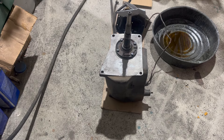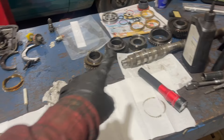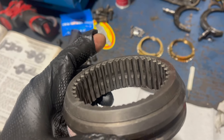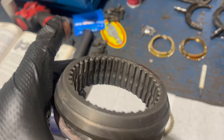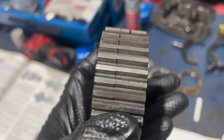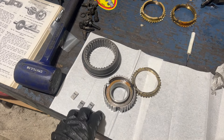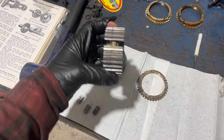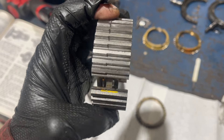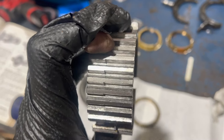Time to move the main case out of the way and start working on the main gear cluster. Preparing to put the main gear cluster together, I'm cleaning everything from front of the transmission to back, inspecting and scrutinizing as I go. One thing I found was on this front shift collar - the 3-4 collar - there's very fine metal in there, which took quite a bit to clean. A more important subject is where it came from: the synchronizer body. That wear pattern makes a lot of sense when you consider this is keyed to the main shaft, so all the power is being transmitted through this collar and this piece.